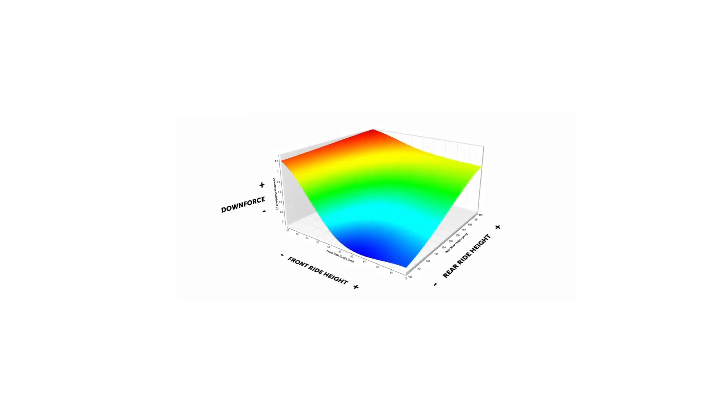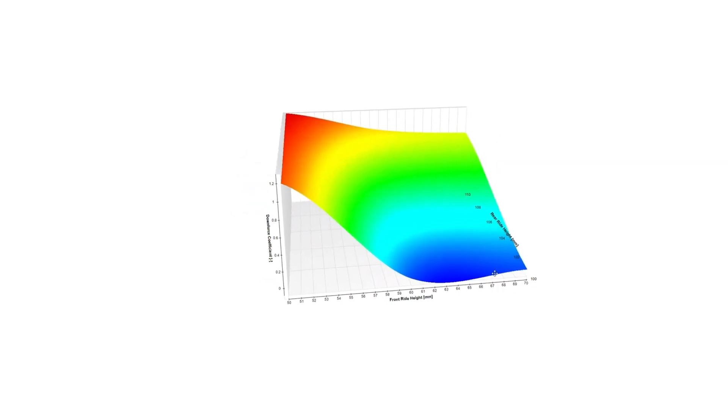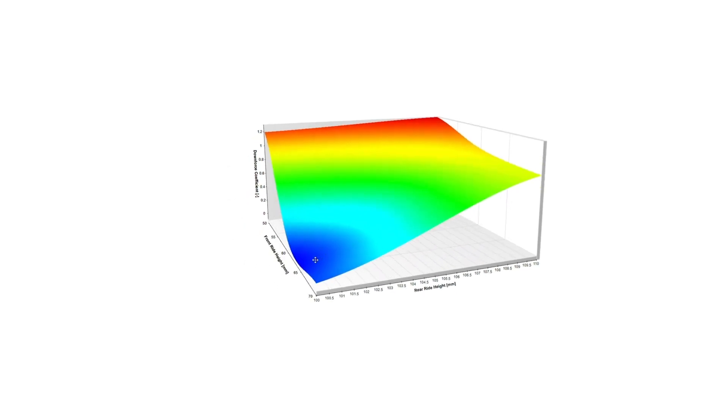The advantage of using a laser ride height sensor is that you're directly measuring the pitch, roll, and heave movement of the sprung mass with respect to the road. If you're building an aero map for your car — running it through different ride height and heave combinations while measuring aero forces — having laser ride height sensors is really important because it builds up a much more accurate aero map. Being able to directly measure the ride height of each point of your car with a laser ride height sensor is extremely useful and has a lot of advantages over traditional methods like damper pots.